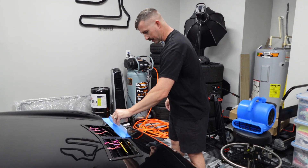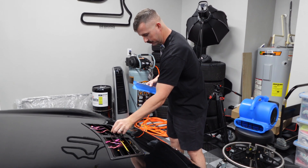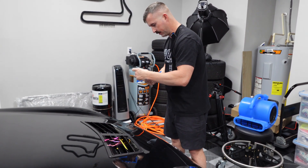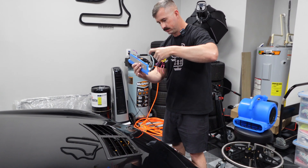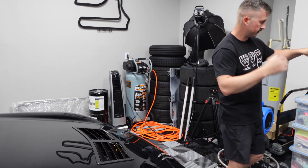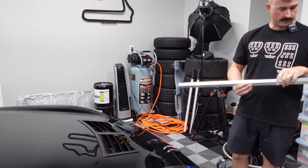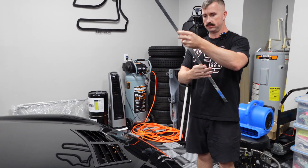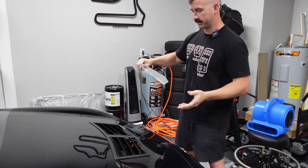That was pretty neat. I'm glad that kind of worked out — I figured it would, but I wanted to test it before I build something and put it on the vent. Now I'm not going to use a piece this tall. The test piece was an inch and a half, but this scrap is only an inch, so in theory it should do the same thing with probably a little less drag. Same principle — we're just trying to get that hot air flowing out, more air in, more air out.